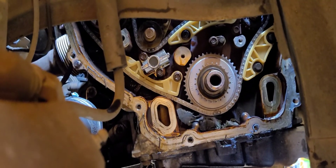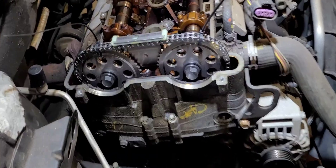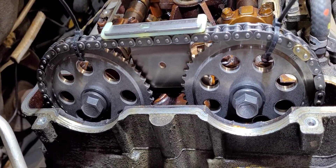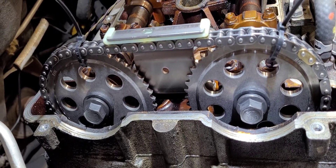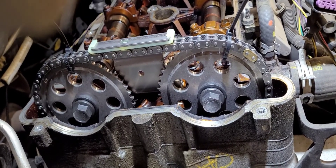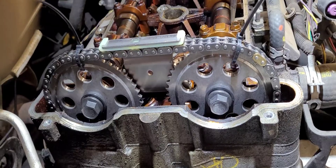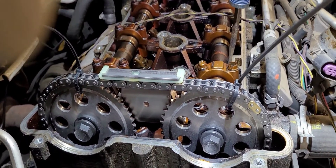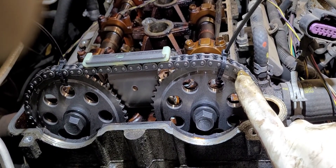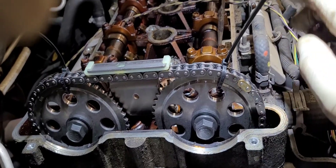So we'll come back on the regular timing components for the camshafts briefly. Here we are with the regular camshaft chain installed most of the way. What I like to do — I could do another video on the full install. This video I just wanted to show you guys how to do the timing marks. So what I like to do is hang this sprocket first with the yellow link first. I always put a zip tie here, and it keeps these cams from bouncing around.